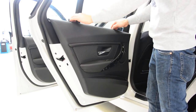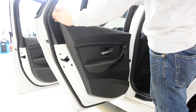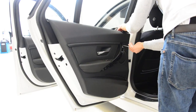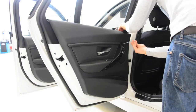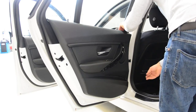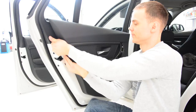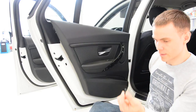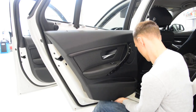Like this and after that you can take the wiper away. Now I will put some force on the door panel in order to remove this screw. Usually the screw must come out. It's completely gone — now you will have just clips. Put your hand behind the door panel and pull it. This is the screw.